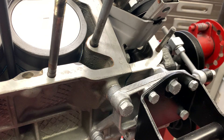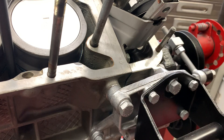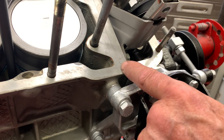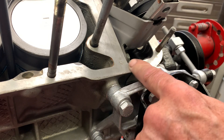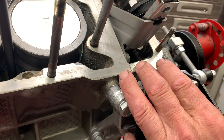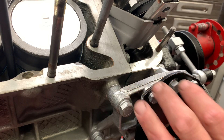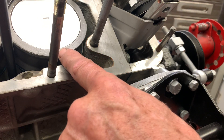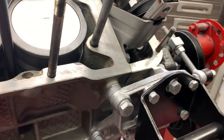I do that to make sure there's not a leak between the head and the front cover on the block at that point. It's particularly important if you had to put a new front cover on, because there's just a few thousandths of an inch difference in terms of the surface between these two parts. I had an engine one time — really nice block — but they had taken, in order to get the front cover off, they had savaged the front cover where the studs go through. They were corroded and basically locked on the engine, and they chopped it up real bad — one of the worst cases of barbarianism I've seen perpetrated on these engines. So anyway, I think it's a good idea and I don't think it hurts anything.